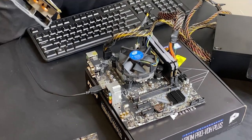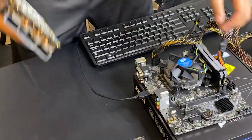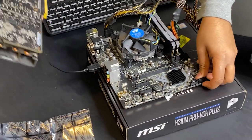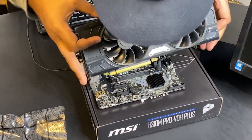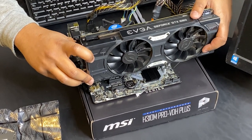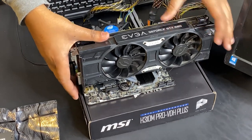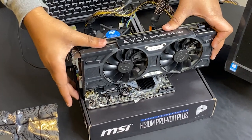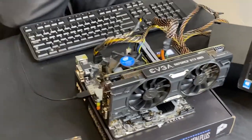What we're going to do before we boot it up is put the graphics card in so we get a display output on our monitor. All you're going to do is push this tab down, line up the graphics card with the slot. Since we're not in the case, I'm just going to do this very carefully — line it up and put it in until you hear a click. Don't push down too hard since it's not in the case, just push down until it's snugly fit.